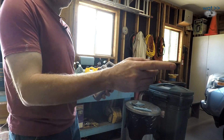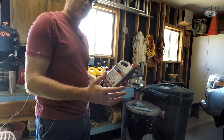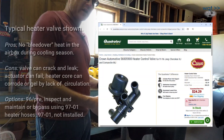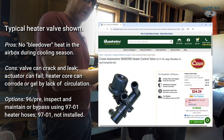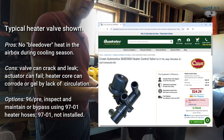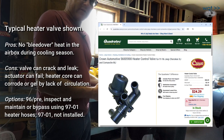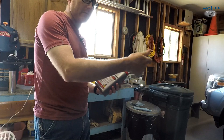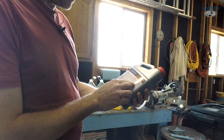In this particular vehicle we don't actually have to run with the heater on max because there is no heater control valve on the '97 to '01 XJs — they removed that. If you have a '96 or earlier, or many other vehicles including our '05 Honda CR-V, they do have a shutoff valve that prevents water from going through the heater if the temperature selector inside the cabin is set to cool.